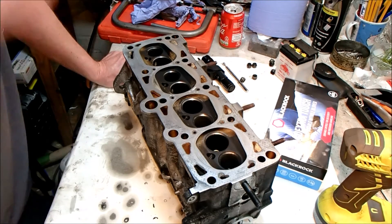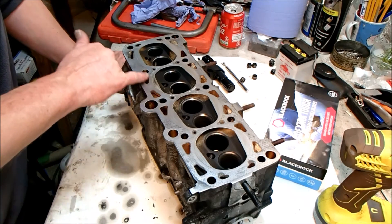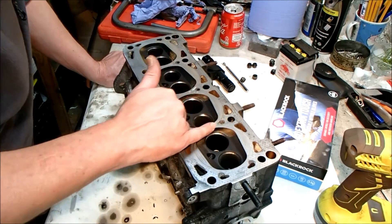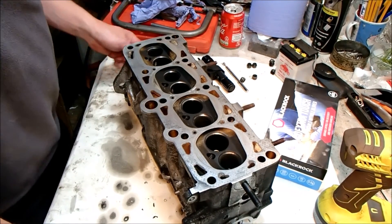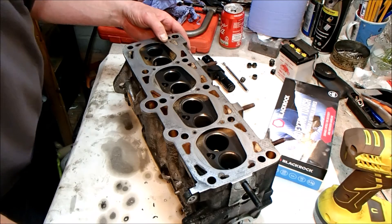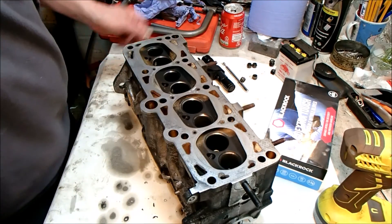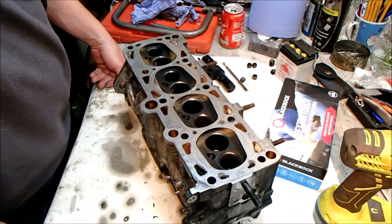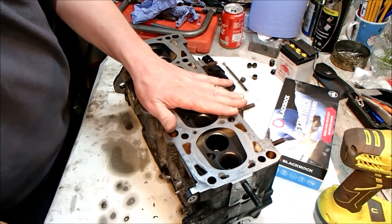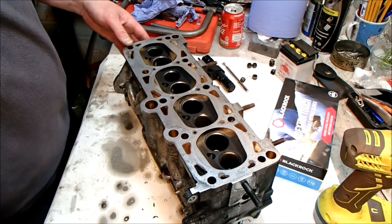Now that I know the head is flat I'm going to carry on cleaning this surface — I want to get rid of a lot of this ground-in dirt. I don't know whether I'm going to carry on with 600 or whether I might step down to 400 grit, which might have a slightly better cleaning action. 600 is quite safe but very time-consuming, whereas I think 400 won't be too coarse. I'll have a think about it. Once I've done that I will recheck the flatness to make sure I haven't introduced any warpage, which I don't expect — I know it's aluminium but 600 is quite gentle.